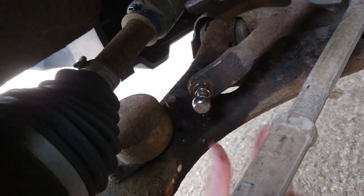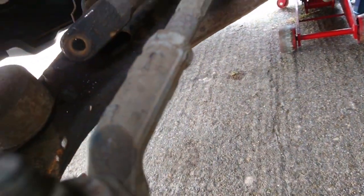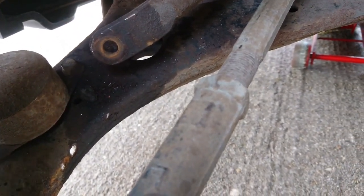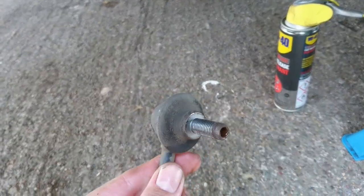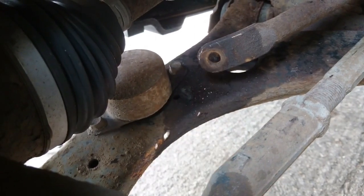If, like me, you have trouble on the bottom because your allen key rounds off, what I did was pull the old one downwards to pop it off and just leave the ball joint exposed. Then I jammed a set of stilsons on it against the floor and used a socket and big ratchet to wind it off. So if you do round off the allen key, it's not the end of the world — just pop the ball joint off to expose the ball, put a pair of stilsons on it, and get it off with the ratchet.